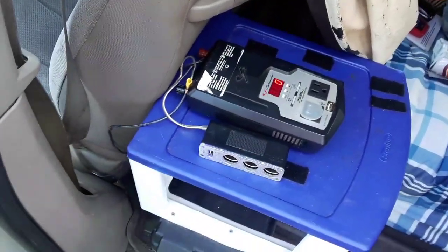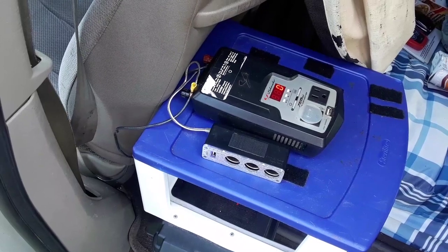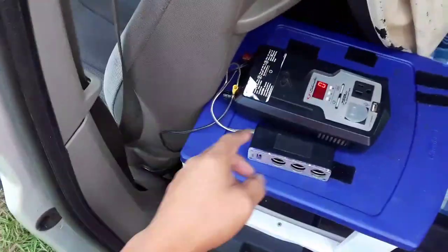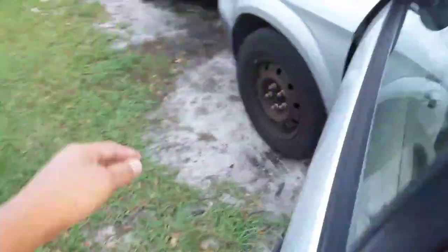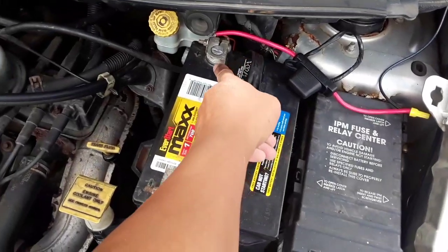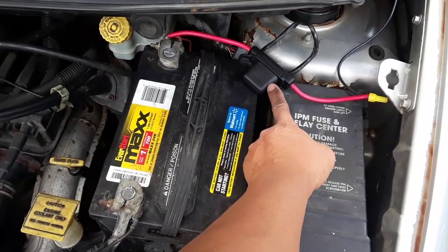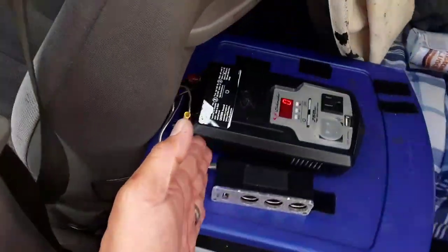The other day we installed a modified inverter cooking system which would allow Rusty Iron Van to cook using the inverter and the rice cooker even without a house battery. You can see the inverter is hooked up right now. There is no battery hooked up other than the battery under the hood. I've installed a wire from here that goes through a 30 amp inline fuse, connects to this black cable routed through to the back to the inverter itself.